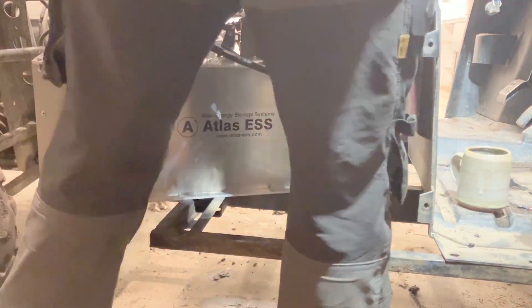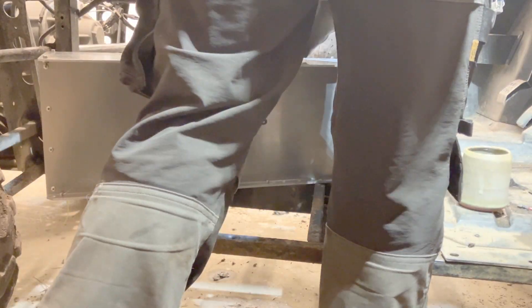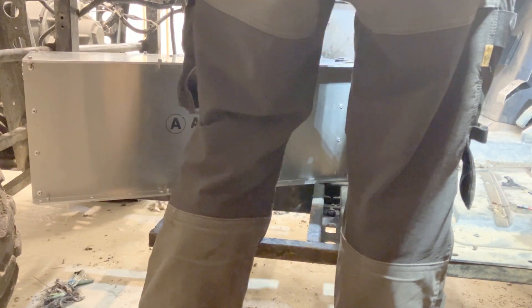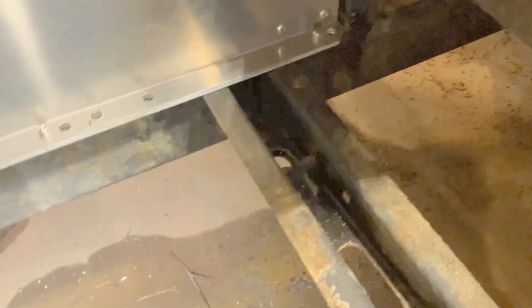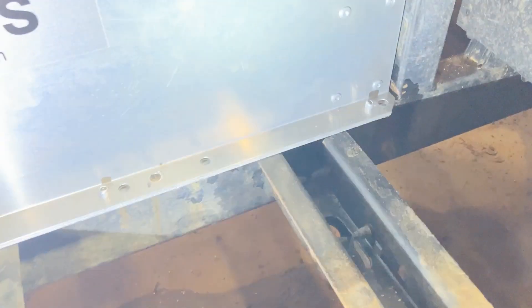This is late at night and I made two mistakes here. One is I would not pre-install the cables — there's enough room to work on it once it's in, but it's tight, and it's really tight for the shunt plug on the passenger side. The second mistake was I hadn't realized that the batteries had slightly different drill patterns on the sides.